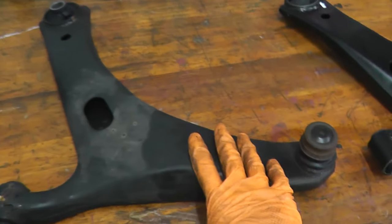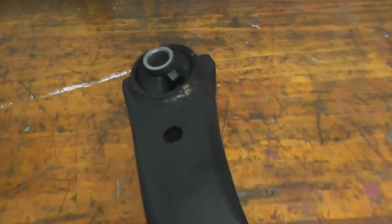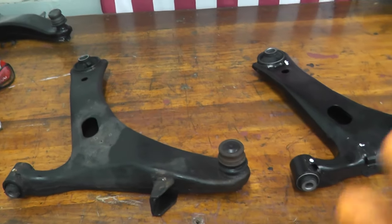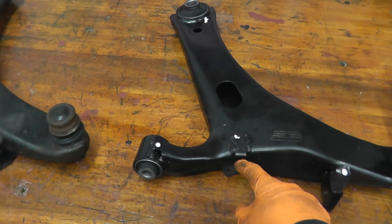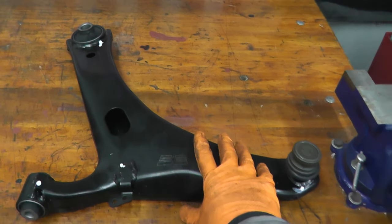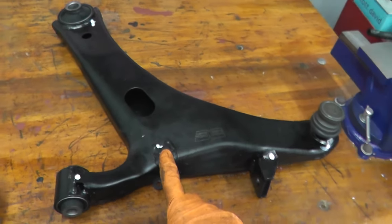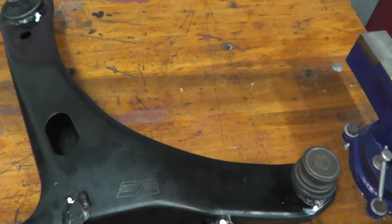Here we have the old part on the left — the ball joint is still in good shape, it's only a year old, but you can see wear and tear on the rear bushings, which are starting to crack on the passenger side. Here's the new part. Interestingly, there's a bracket welded on the new part that doesn't exist on the old one — that's because this is a Dorman part, not a Subaru part. I've used Dorman for years with no issues. My guess is it also fits the Forester and other Subaru models, but I double-checked the part number and it is the right part for this Impreza.